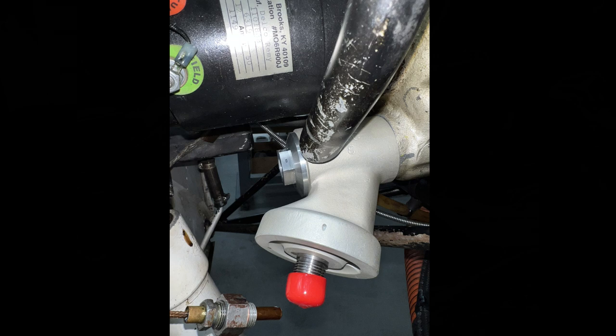It screwed in by hand all the way in fact — I wasn't able to do that with the other one. So in conclusion, I'm not sure whether it was the galled threads on the old F&M or whether I was running out of threads in the accessory case. But one of the two fixed the problem, so I'm happy now. It's tight as hell — I'm not worried about that filter leaking anymore. That worked really well.